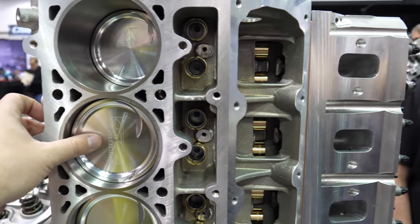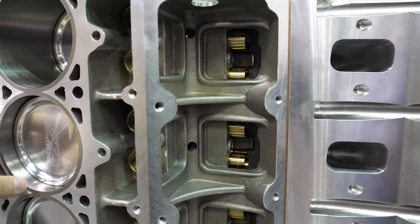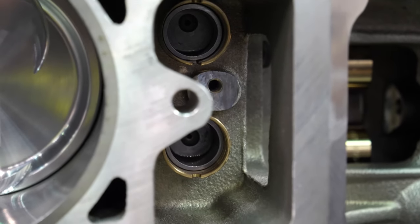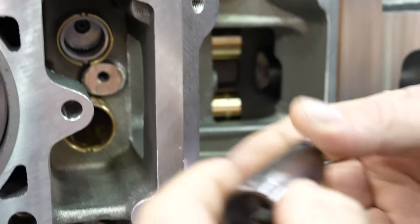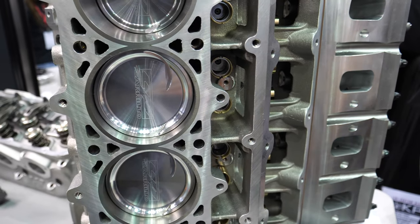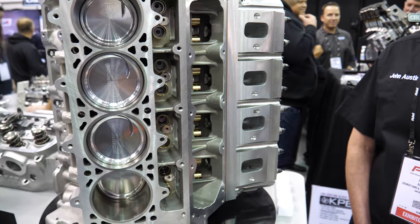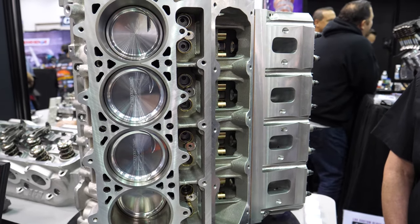We're also offering now our own keyed lifter. So that's what the bronze keyed bushings and lifters are all about — the bronze keyed bushings, to keep it alive. The advantage of that is less weight, more durable setup, and it also gives the engine builder or machinist the freedom to move that stuff around if you're wanting to spread the lifter bores, move things around, change lifter bank angle. Now you don't have to contend with a link bar — each one is actually truly independent.